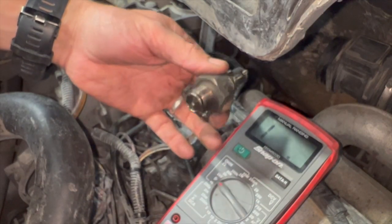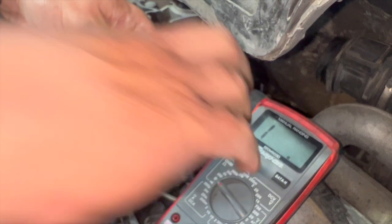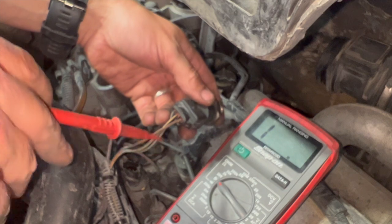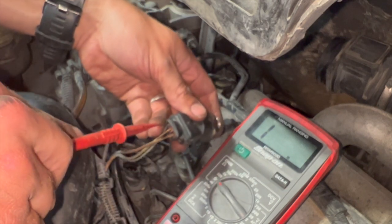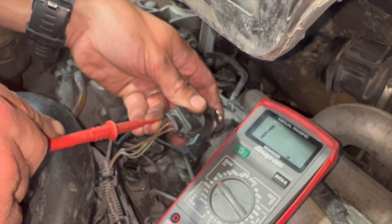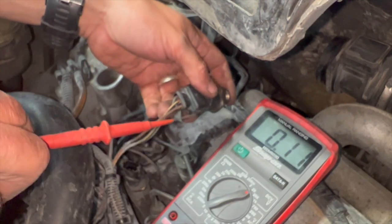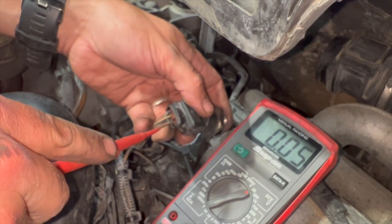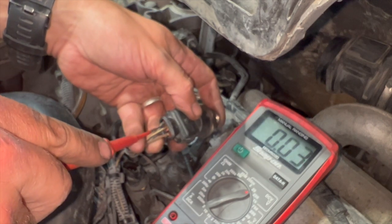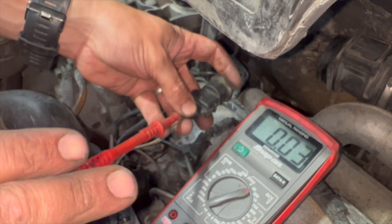This is the old faulty sensor. I'll put links in the description to where you can get a replacement. I'll plug it in and show you the readings. With it plugged in and on continuity, checking the earth first — nothing changes, still a good earth. Flipping over to voltage, pin three still shows its five-volt feed, but on the reference wire it just pulls straight down to nothing at all.